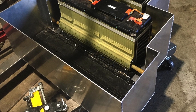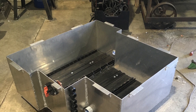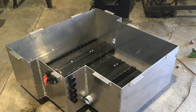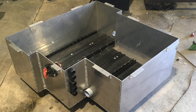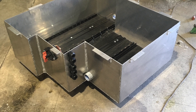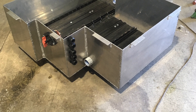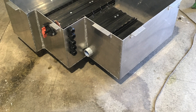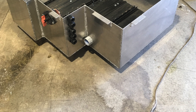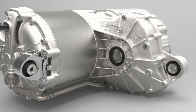The coolant fittings on either side of the batteries are pretty tight, so I wanted to make sure I'd have room to fit coolant elbows onto those fittings. Here's a shot of the finished box — it has a port for a coolant fitting, the master disconnect safety switch, and cable glands for the high-voltage wires and BMS wiring. Under the box there are mounting tabs, and having the box flush with the top of the frame left space underneath to mount other components: the DC-DC converter on the front, and underneath I mounted the Chevy Volt charging unit, the main control box, and the high-voltage contactor box.